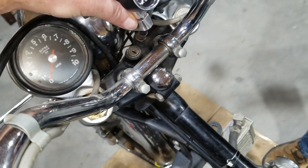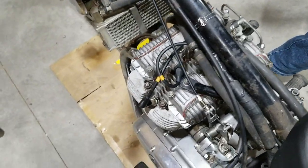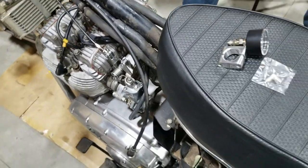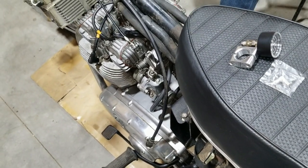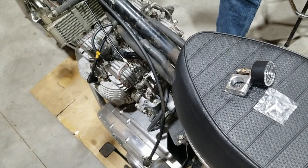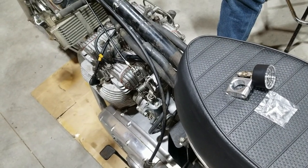I'm not sure exactly where, but if we don't have good pressure, we can have a problem with the main bearing pretty much, right? Yep. So if it's got low oil pressure, the motor's going to have to get rebuilt. Well, we don't know anything about this motor. We're going to find out as soon as we get it running. So anyway, let's get going. We'll drop in the oils and stuff here, hooking all this up.